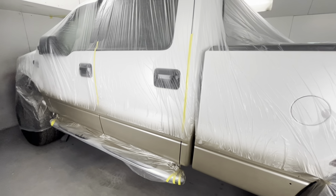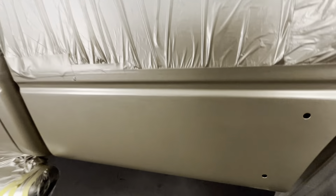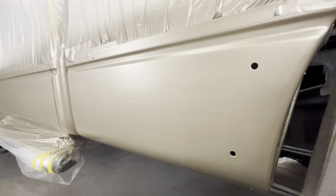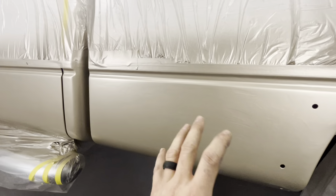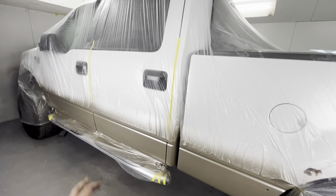We're going to stop and apply a 2K primer over all of this to really lock things down. On your base coat you have about 12 hours that it can sit without having to scuff it, and you can paint over top of it. So if we shoot our primer in these areas, come in in the morning, wet sand our primer out, then we can continue with our base coat and hopefully our primer will lock it down. This panel right here — the paint just absolutely hates it. It has just lifted where it looks like literally no prep work was done at all, but everything was blocked. So let's put a 2K product over these trouble areas and let it sit overnight.